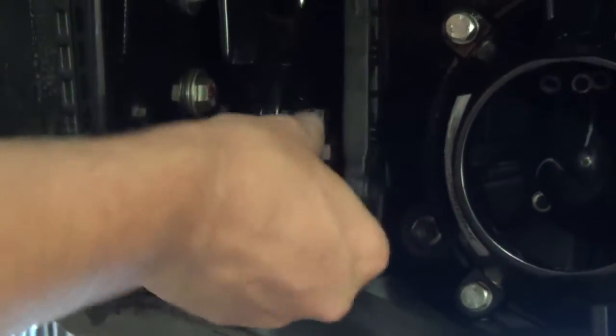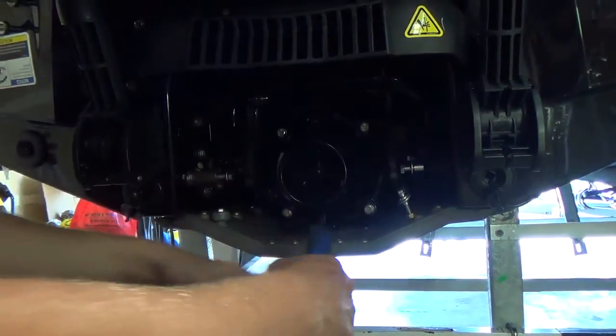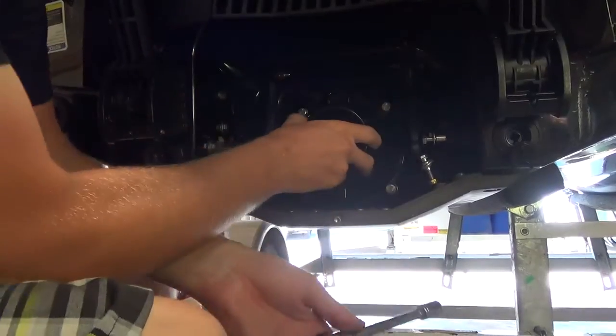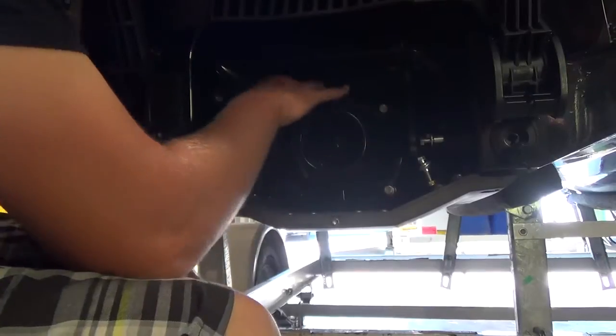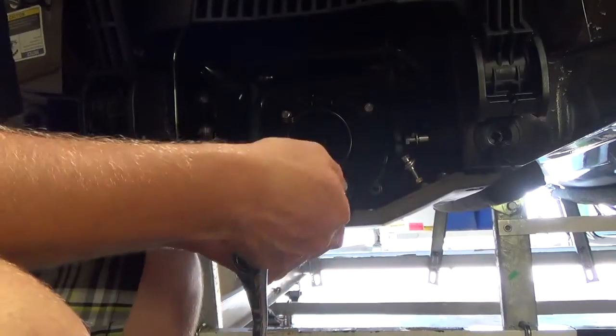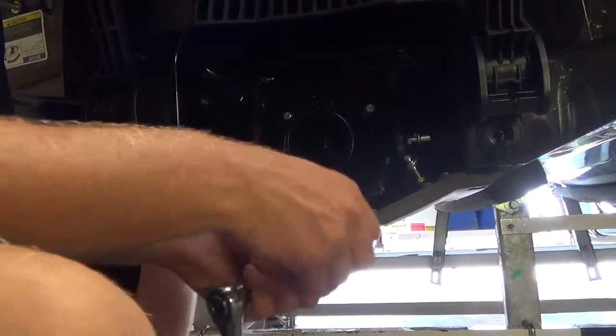And then the final piece to remove is this nozzle connected to the jet unit. So I'm gonna go ahead and take that off real fast. And then after we get all this stuff off, I can show you how to install the thrust adapter. When you're removing this here, remember to set these bolts aside, because with the thrust adapter, we're actually gonna use these factory bolts to put it back on. So don't lose those, don't damage them. Be sure to take some care with these also, because they are stainless steel, which is a little soft sometimes. And over tightening them or forcing them back, if you're having any issue with them, can cause the head to break off, and you'll have a big issue if that happens.